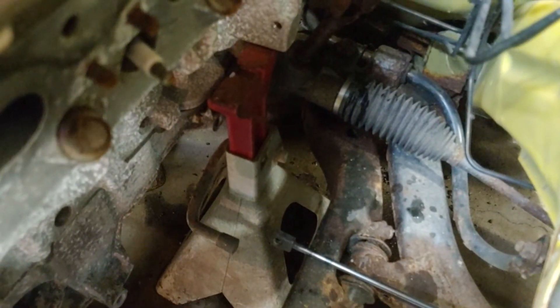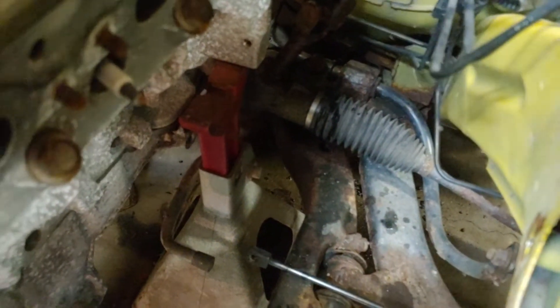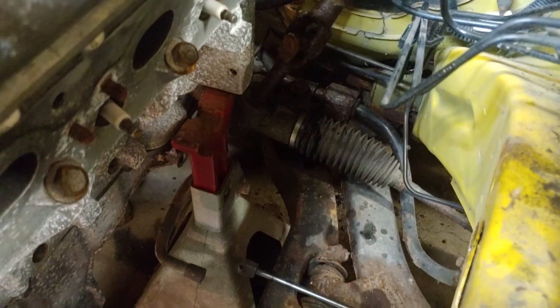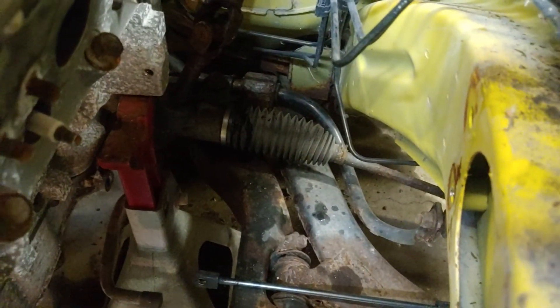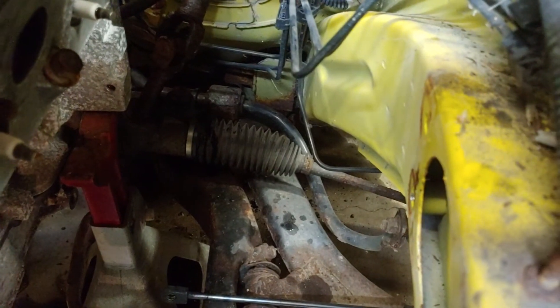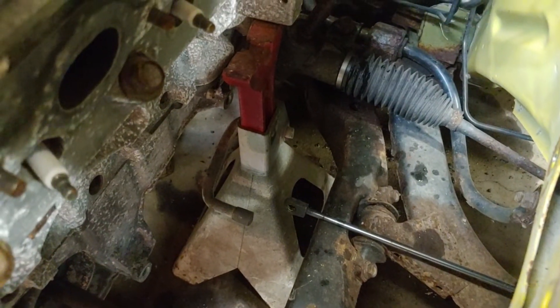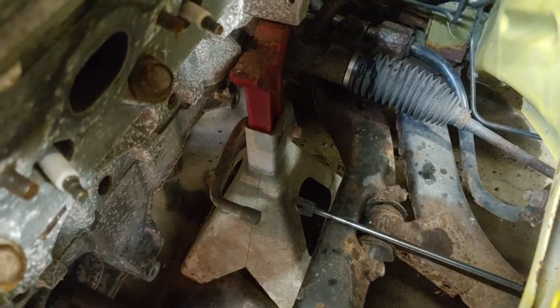If I put the knuckles up front swapped and I turn the steering wheel left, the tires are going to turn right — there's no reason to hang on to that rack, they make plenty of steering racks. I'll have to take some measurements and see which one fits up front. I was also looking at different steering linkages available in the aftermarket. I don't think it should be too difficult to bring the shaft way over to the outside, sneak it down the inner fender well, and get it to the rack and pinion. That should work, and then I'll have no trouble running exhaust through there.